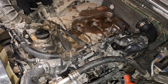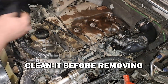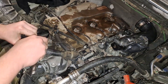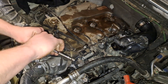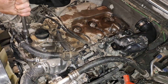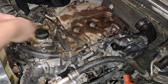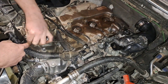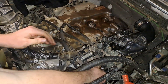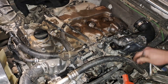After the test is done, you're going to want to undo all the mess you've made. Remove the wires that you had to move out of the way, obviously take off the plugs from the injectors — just wiggle those loose very carefully — and then unbolt your tappet cover to get to your actual injectors. For this part you'll only need a 10mm socket, with a few 12mm involved, and then you should be good to go.